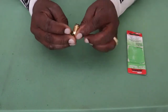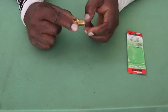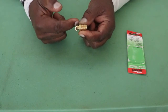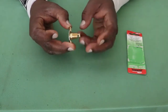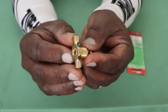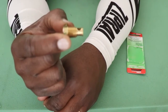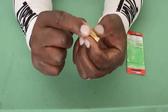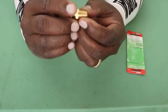This drain plug I've selected is very simple. When it's plugged in like this, this is the closed position — water can't get out because there's no opening. If you screw it in, you expose this opening. It's basically a through pipe. That's where the water can go through and then out this end. This is a very strong and good way to seal the valve for the drain on the radiator. I'm going to put some gasket sealer in the thread so it doesn't leak, and then we have a nice strong brass fitting that can make the cooling system secure and no longer leak.